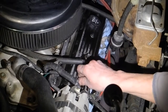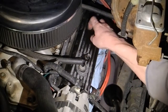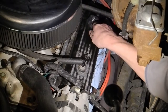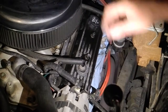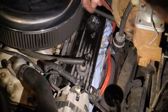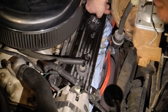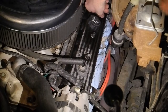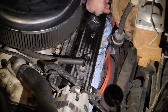I've done the passenger side and now I'm doing the driver side valve lash adjustment with the engine running. Different people and different schools of thought will tell you that to get the proper valve lash adjustment, you loosen the rocker arm screw nut until you hear a clacking sound and then you tighten it either half a turn, three quarters of a turn, or a full turn until the clacking stops.